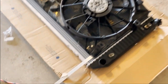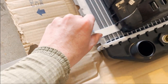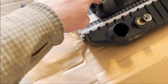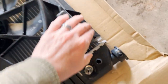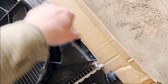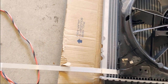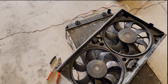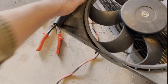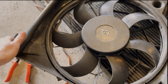Testing things out with the new radiator. A little bit of three-quarter inch by eighth inch aluminum. I'd like to slide it all the way but there's a notch here, so I'm going to bring it to the edge of that notch. That will keep this corner from ever diving into the radiator again. I'll just do my self-tappers through the flange up top. For the bottom, I got some heater hose - I'm going to put some heater hose in there as a gasket along the bottom, which should also help protect things from rubbing through again. She was a good radiator, lasted years. Half-inch heater hose cut in half and slipped on over there provides a rubber bumper, so we don't have that problem ever again - in theory, according to prophecy. Hopefully it works.